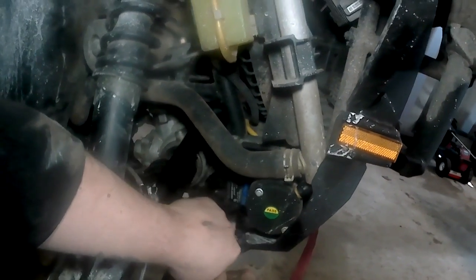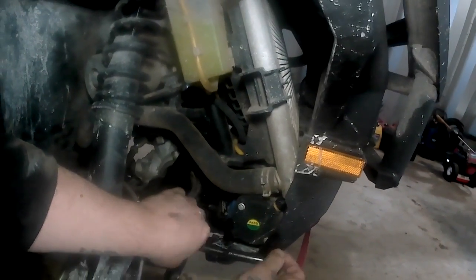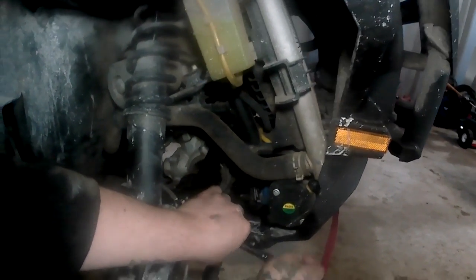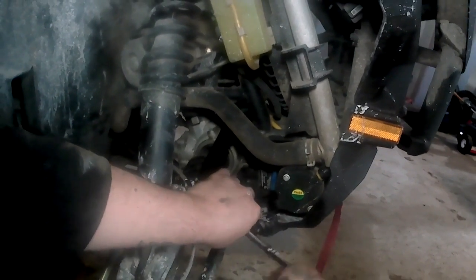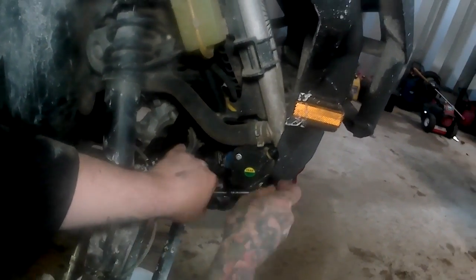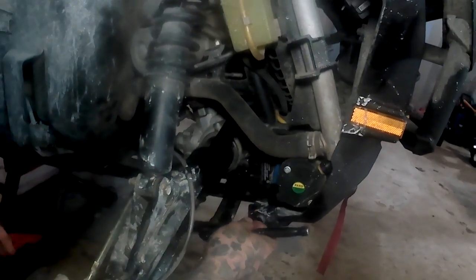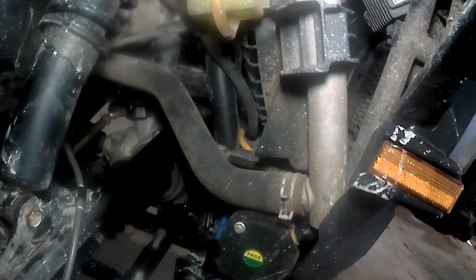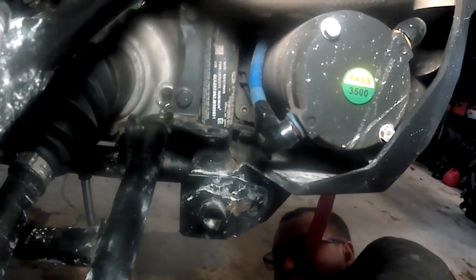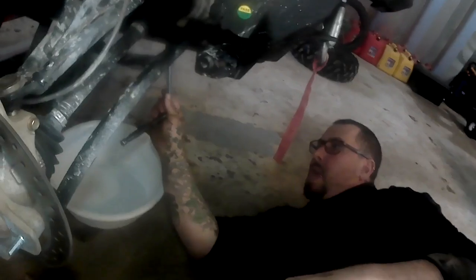Let's see if we can get away with this one water free. We think we've found the problem with why we filled the rear differential and the transfer slash water pump — the air vent literally goes right behind the rear bumper, and this is water we led through the pond a few times. So it just acted as a scoop and scooped everything right up. And it's full of water too by the looks of it.